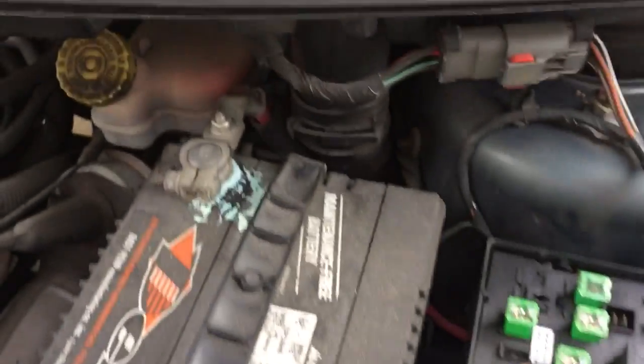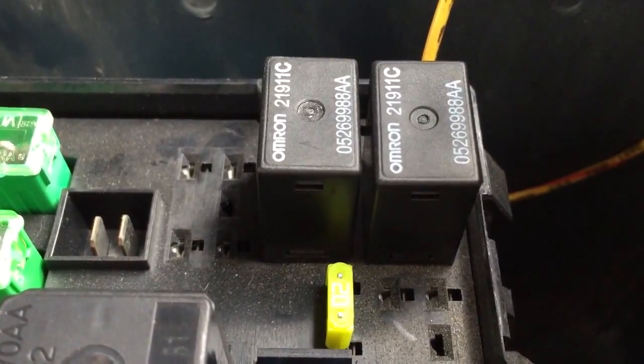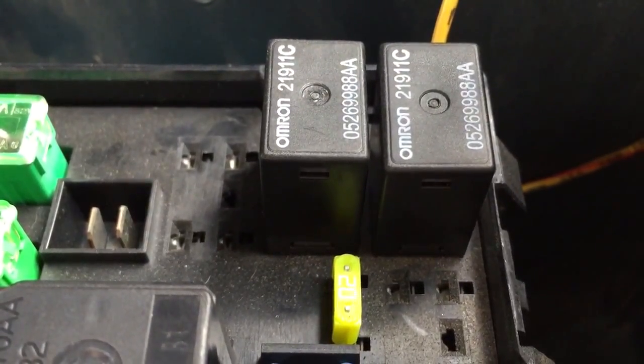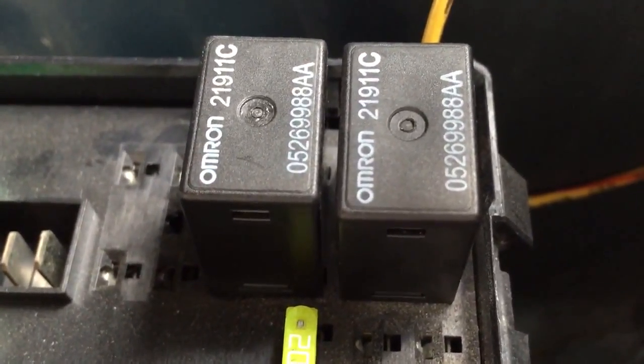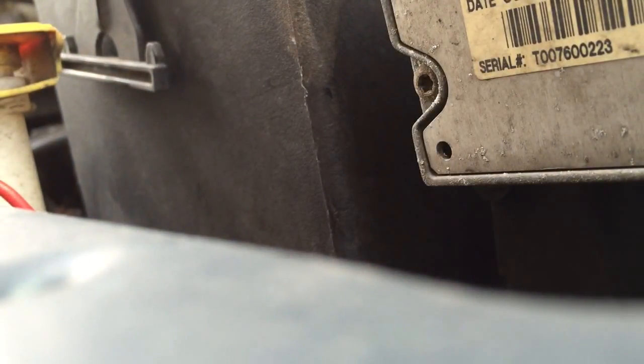Okay, let's give it a shot. Battery's installed — we're going to do our first test. Off camera I went ahead and hooked the battery up, and before putting the wire into the hole I put the relay back in, just to see if loosening everything up and putting it back would fix it like a loose connection. Didn't go. So I went ahead and put the wire in the slot I mentioned — this corner of the relay — put the wire in, pushed the relay in on top of it, and let's give it a shot. All good.